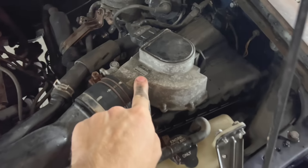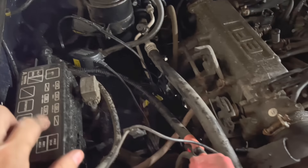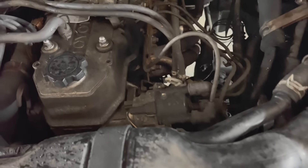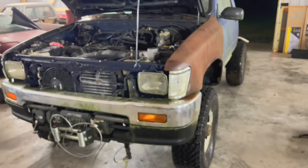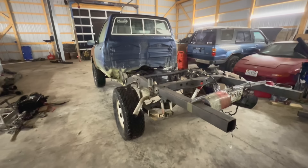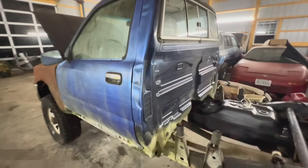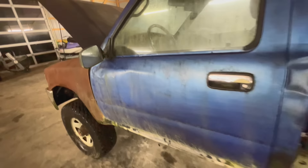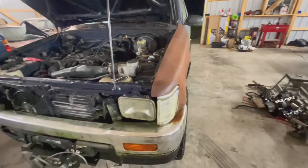I think the airflow meter has to detect airflow before firing the injectors. There may also be a fuse blowing that's not telling the ECU to fire the injectors. Luckily it is a distributor-based system and it is getting spark, so it's just no fuel. I'll figure that out and then start tackling bringing this thing back to its former glory. I still have the bed for this truck - had it sandblasted. I got a new fender for it. This truck was actually rolled on its side one time, so it's got some damage there that'll be fun to pull out. It's got some dents and has slid on the side of the cab. I've got new doors for it.